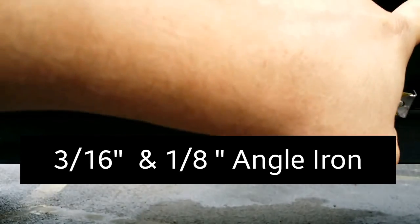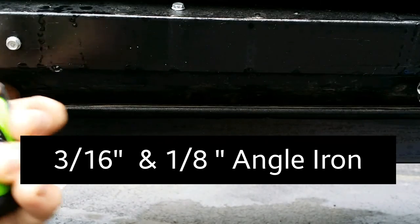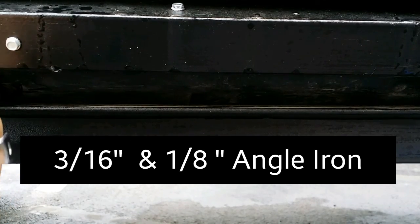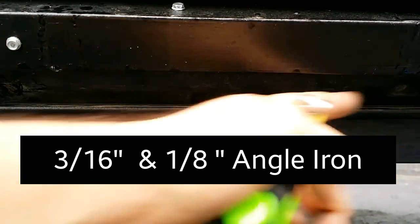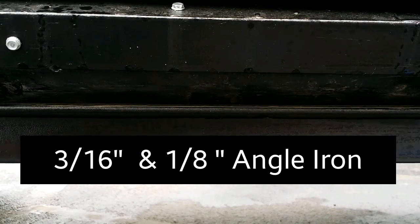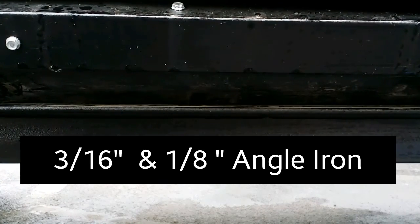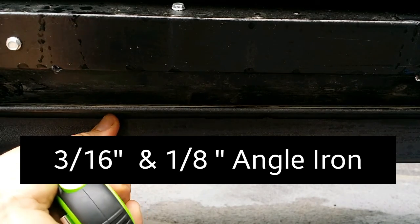And the reason for that is right here. Here's the front door. Here's a back door. There is a dip in the body. I made about a 1/2-inch notch just on the back side of the angle iron. Measure about a 1/2-inch deep across the top, 1/2-inch deep across the bottom, and just notch it out using these 2 measurements I gave you. So when you bump it up there, it stays as flush as possible across the bottom of the body, as close as you can to the pinch weld seam.